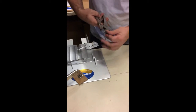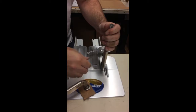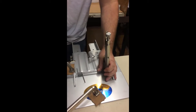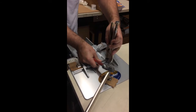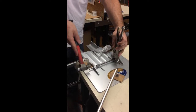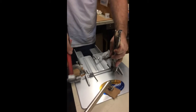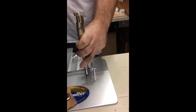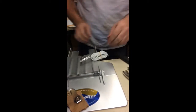I'm going to do the same thing to this spring. Compress it, press it flat. That way I could get it started here, and I'm going to tap our rod easy so that I can get it lined up. Now I can hold that rod down with that side and tap it, and now line it into the receiving ears, and now the rod is all the way through and where we need it. So now I can release this vice grip, and the springs are in place loosely.